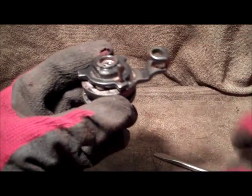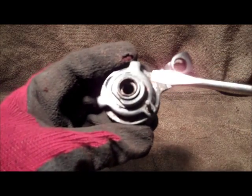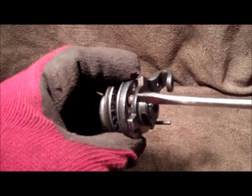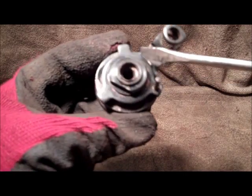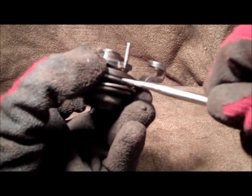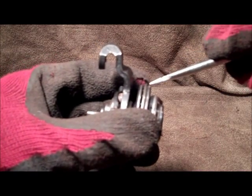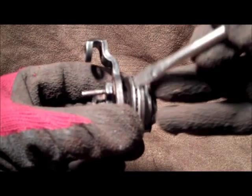This is the adjustment arm. Here is the bit that's retained in the thrust plate. In my last video you would have seen the one off the salvage bike - it was actually cracking at the point where the ball bearings pressed against this plate, and the ball bearings were heavily corroded. In this one though, this plate looks to be in good condition - it's got no cracking. The ball bearings themselves look to be in good condition. We've got the thrust bearing that sits here - these three plates, two washers on the outside, and then the race and the bearings. A good thing to do is keeping the unit together - you can see inside here the rollers.